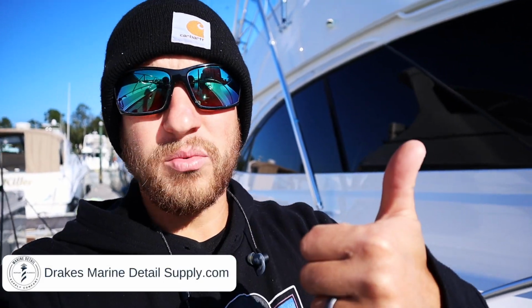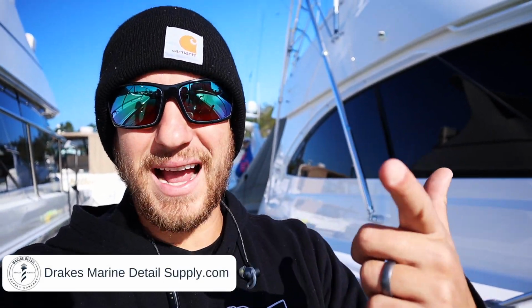We are out here in Orange Beach, Alabama, doing this 52-foot Viking. There are some major hard water spots on the glass, so we're going to be learning how to remove the hard water spots, how to properly polish glass before you do your protection, and then we're going to talk about ceramic coating and why ceramic coating on your glass is going to be your best option for protecting your glass.